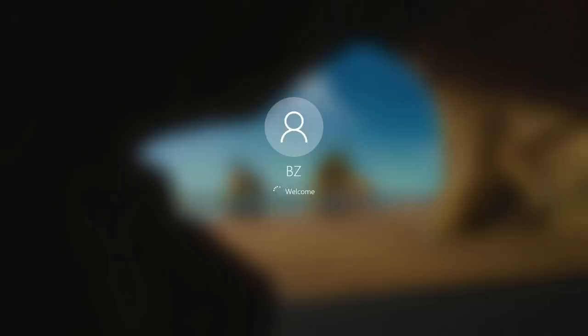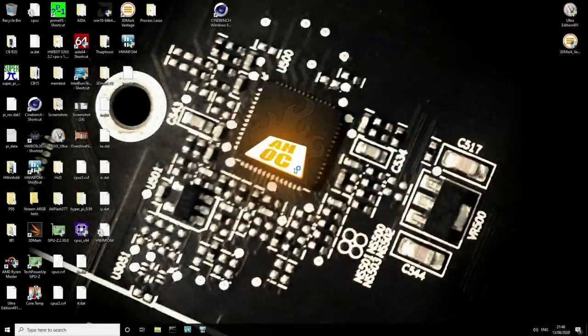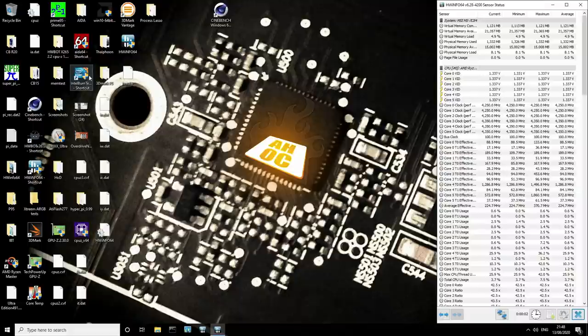And then eventually what I would do is run Prime95 with FFTs from 32K all the way up to 100. No, for Ryzen, I think you should go up to like 256K. On Intel, once you go past like 192K, it doesn't really change. It just gets really cold and basically worthless. But on Ryzen, because the L3 caches are so big, I think 192K is still really hot and hard to run, but I'm not sure, so I'd probably go up to 256K. So I'd run from 32K FFT size all the way up to 256K FFT size, and I'd run that for an hour, and then I don't know.